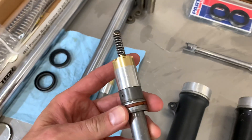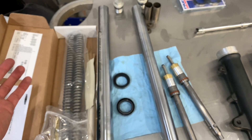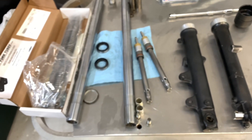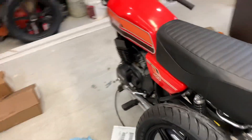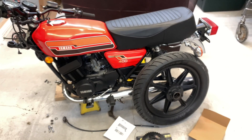You can see this is the finished product. The next step is to put on brand new fork seals, and I bought new heavy duty springs — these are suitable for a person who's about 175 pounds or so, so they're a lot stiffer than the original springs that were in this bike. Between the springs and this new damping feature, I really hope this is going to work well. I'll put it back onto the bike. You can see it's a bit of a disaster, but the bike is coming together — I've got the tire mounted onto the rim and the rest of the bike is coming along.